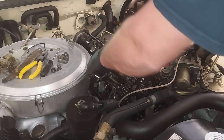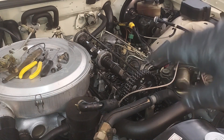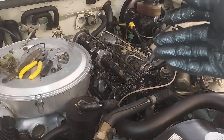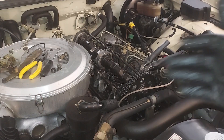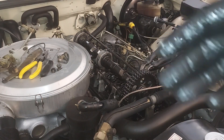I think typically what I've noticed is exhausts often need adjusted but intakes don't, because the exhaust valve is obviously running a lot hotter — hot exhaust gas is coming through there. So maybe that has an effect on the valve lash over time.